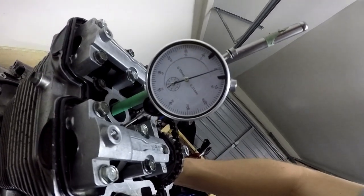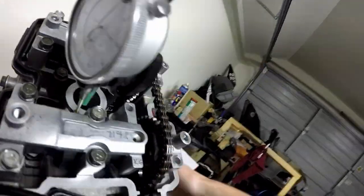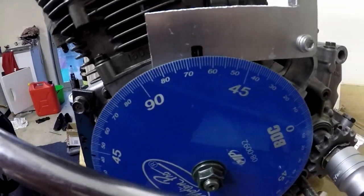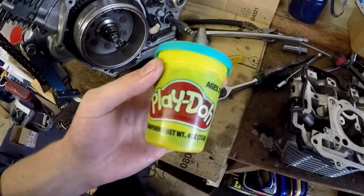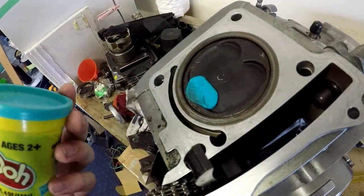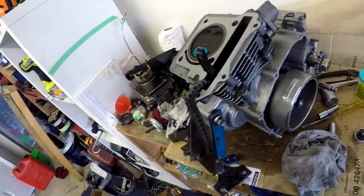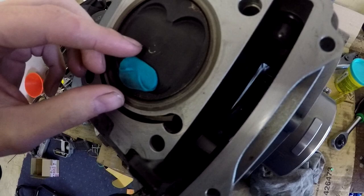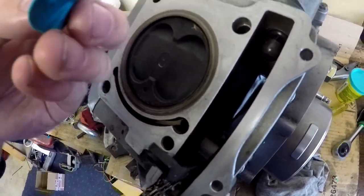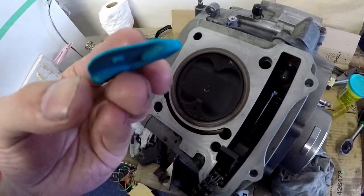Trying to find where the exhaust starts opening — right there — and that is our timing mark. We've got the cylinder head off. We put a little bit of play-doh on the piston just where our exhaust valves are, put the head on, done up the bolts, put the cams in, and did one revolution of the camshaft — so two revolutions of the crank. Now we've got our indication of how much clearance we have, and just by looking at that we have heaps of clearance for the exhaust valves.